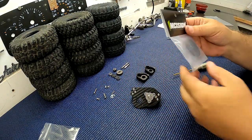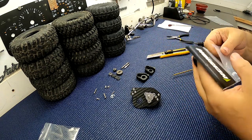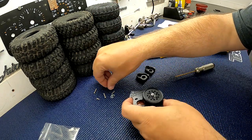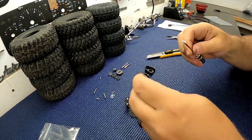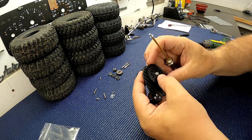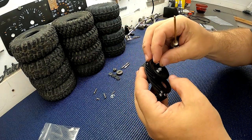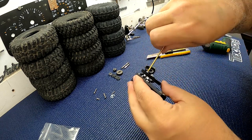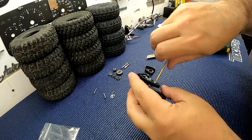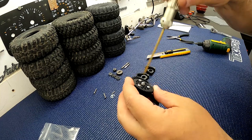Now open up your Incision 52-tooth spur. Nice little unit. You're going to use these little 6 millimeter screws — find the right bolt pattern. Don't just cinch one of them up: get all three started first before you cinch them down. Get all those started and give them a decent amount of tension.